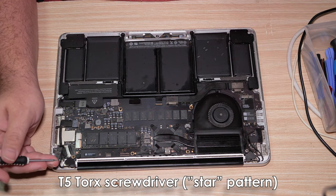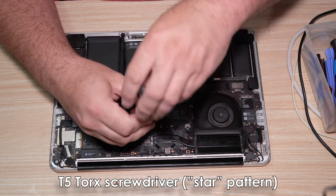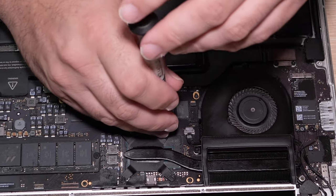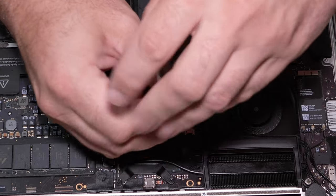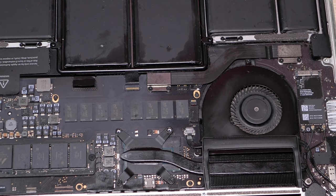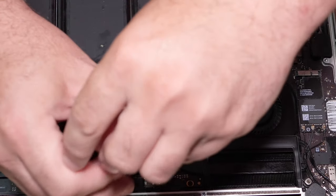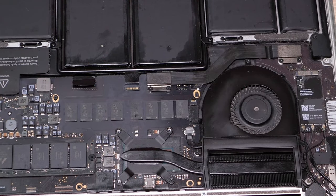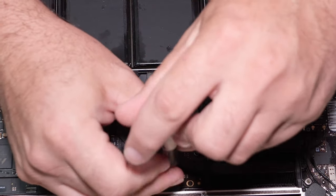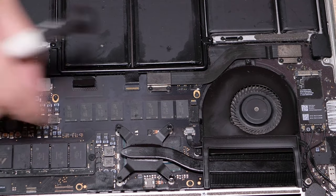And it's just a long, drawn-out process. T5. CPU screws. The other reason I'm documenting this is so that I can see where I have put any given component I have removed. I'm taking them out in order and putting them in front of my keyboard left to right. And once I run out of room left to right, I will wrap around and start going top to bottom. And so on. Grouping things logically.